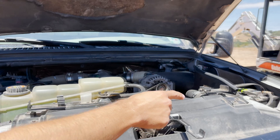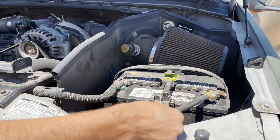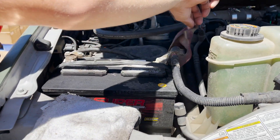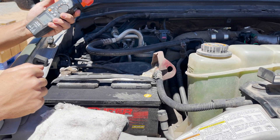Let's start on this side. There is one battery and this is the positive cable that runs to the other side. This is the negative cable to the frame, and then over here the positive cable continues through to this block right here where it splices on. We have a little bit of a bad connection there, which is honestly kind of typical for lead acid.